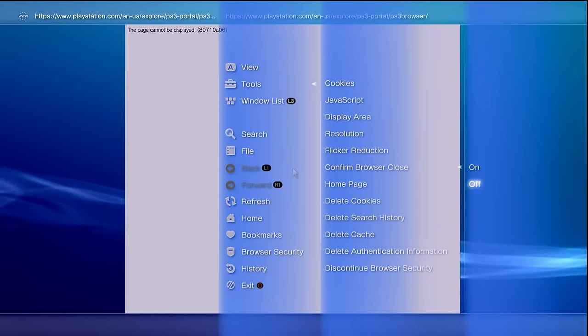When we download the custom firmware and extract it, we have to make sure it's not corrupted so it will install properly. You can use whatever method you want to check the MD5 file hash. I'm going to link an online tool. Finally, you're going to need some homebrew. One of the first pieces I recommend is Multiman — a nice backup launcher that also lets you backup your own game discs from PS1, PS2, and PS3. Download the Multiman base and don't worry about the version number, it will work fine on higher firmwares.